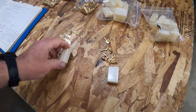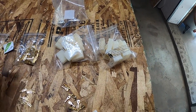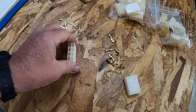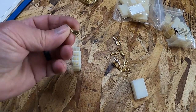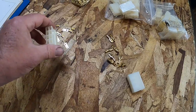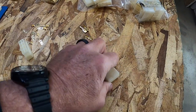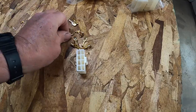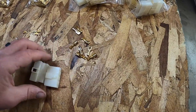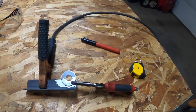I can't buy a Ford connector that fits, so I'll graft on a new connector — a nylon connector I got on Amazon, I'll put the link in the description. It comes with eight-pin plugs, which is what I need. I'll strip back the wires, crimp them on, then solder each one. Once the connectors are on, you shove them into the back of the unit — it snaps in place. Then anytime I want to take the steering column out, I just unplug that connector.